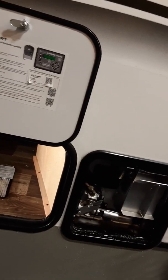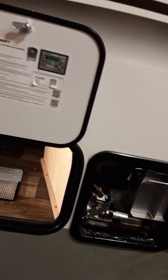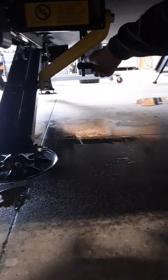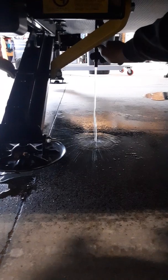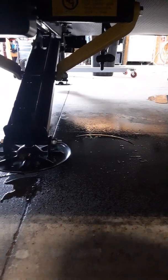I just want to practice. Can I pull up the fresh water drain? That's what I need to show you. Right here. It's a little hard spot, but this blue tube right here. It's off right now, so no water should be coming out. Turn it on, and all that fresh water is going to drain out. When you do your winterization, that's what you're going to drain.